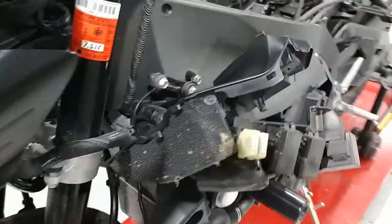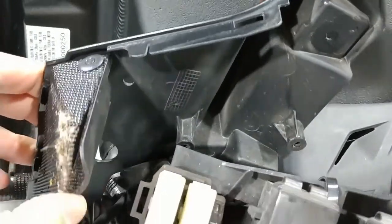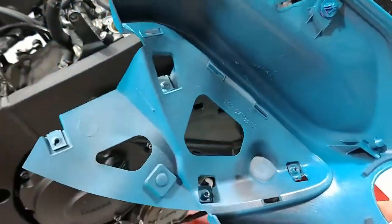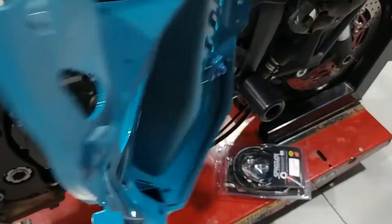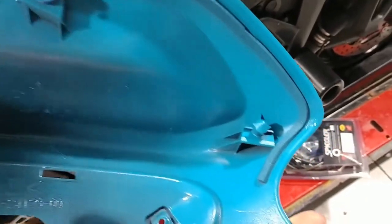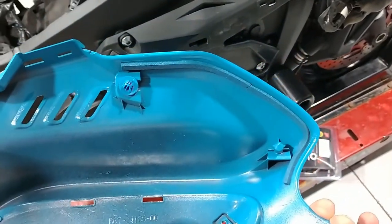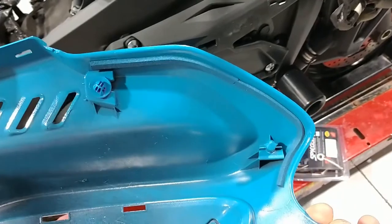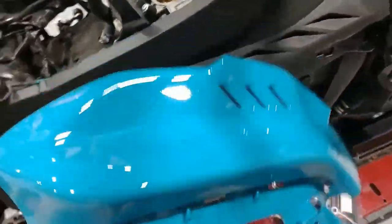Each side is going to be four screws, and they're buried behind all these cables and harnesses — there's two of the bosses right there. You've got four of those and they both have to come off. You're also going to have two pop rivets, so even once you take off all the other fasteners, those are the two pieces that are going to hold it on — kind of up in that top corner. Just pull those straight out, don't pry. Nice and firm — don't bend the plastic too much, you don't want to break these pieces. That's the case on both sides.